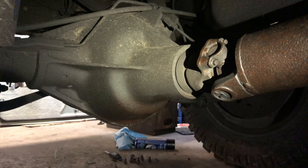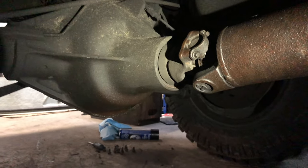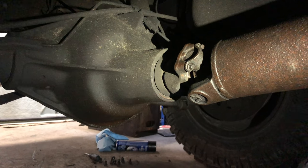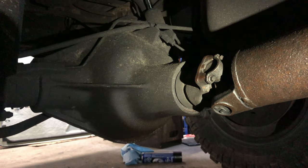One of the things that needs to happen before you can do anything is disconnect the driveshaft. On my truck, when you pull the driveshaft out of the transfer case, it just starts leaking. What I did was tie a rope around it and up to a cross member to hold it up against there — make sure you do it very securely. If that thing falls and hits you in the head, it would be a big problem. Otherwise you could pull the driveshaft and stuff a bag in there to stop the leaking, or just drain the transfer case altogether. Just make sure that's all taken care of before you start driving again.